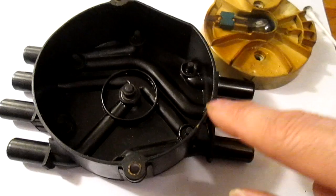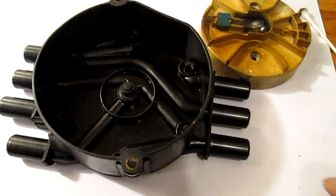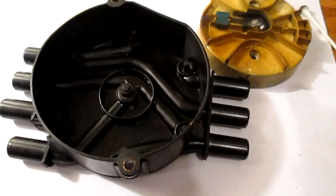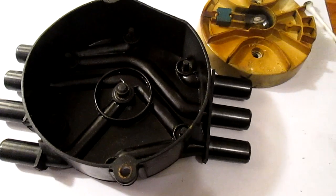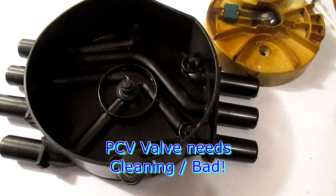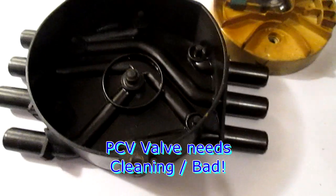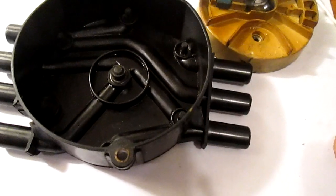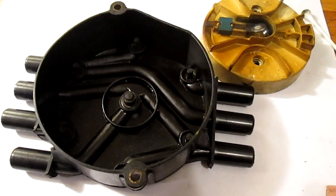That's what I found when this thing was wet and I was trying to figure it out. I've seen a lot of people with videos who didn't really explain exactly what happened, but I found out that by modifying the PCV it was able to get all the moisture out and started working fine. Basically I had clogged the PCV, although not intentionally — that's what happened.